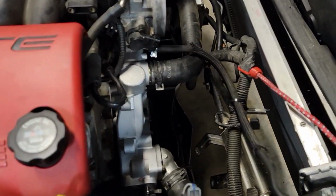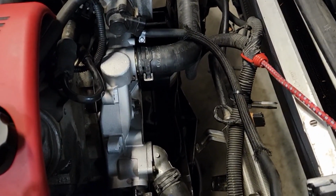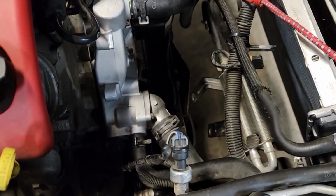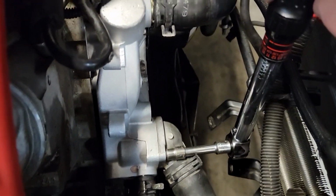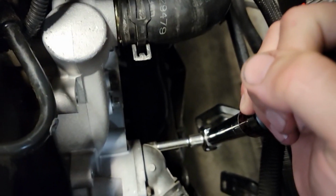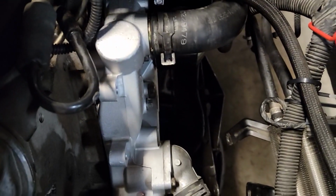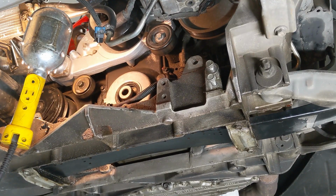Guys, finishing up the water pump install, it really is super simple. 6 bolts for the water pump to the block, a couple bolts for the thermostat housing, and a few hoses. And I just want to remind you one thing, real men use torque wrenches. These little bolts are too easy to break, guys. Thermostat housing is 11 foot-pounds. And the bolts that hold the water pump to the block, the first pass is 11 foot-pounds, followed by 22 foot-pounds. All right, back to the harmonic balancer.